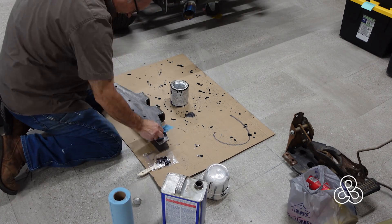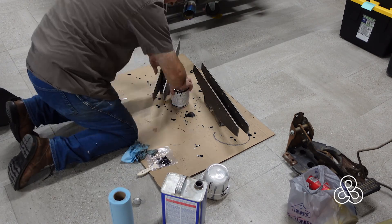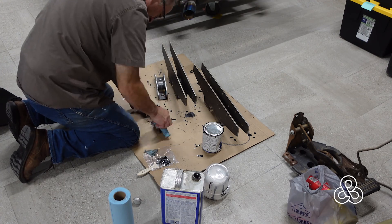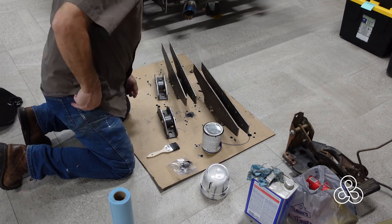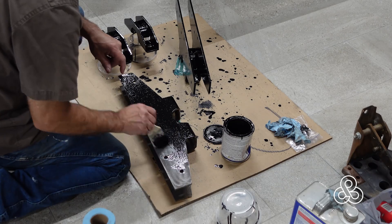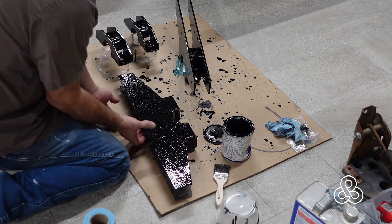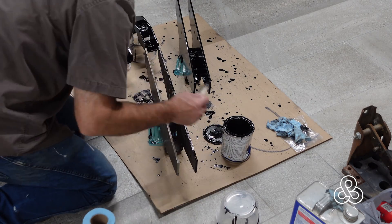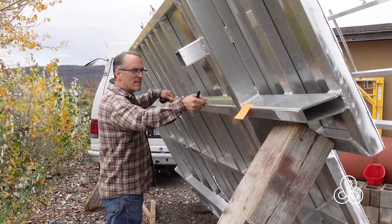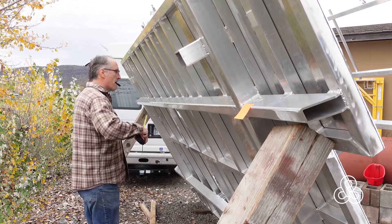Once all these pieces have been fabricated, we're just going to paint them all up with some rust-preventive chassis coating — clean them up, degrease them, and start slopping this black rust-resistant chassis black on there. I'm not trying to make these very pretty; just going to take a throwaway brush, get a lot of paint, and really drop it on there so that it runs into all the nooks and crannies of our welds and joints. It just needs to keep these things from rusting — they will be on the wet side of this vehicle where water and mud gets thrown around. Now they're all painted up; time to try bolting them to the subframe.